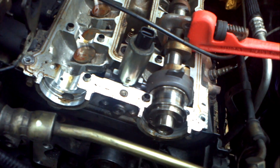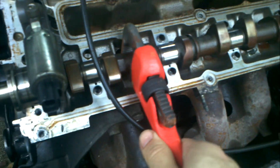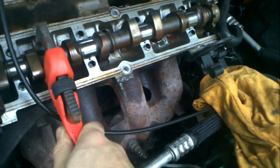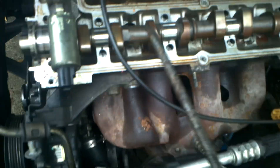So that's how you do it — if you have a bad VCT or you need to remove the head, you just need to remove that camshaft. That's how you remove the VCT. This holds onto the cam like that. I've already loosened up the cam — all the retainers are off — so this should just come off. I don't want to damage anything, but that is hard in there. Maybe if I just spin it a few times. I'm going to put some leverage on it — just play around a little bit. There you go, that loosened up right there.